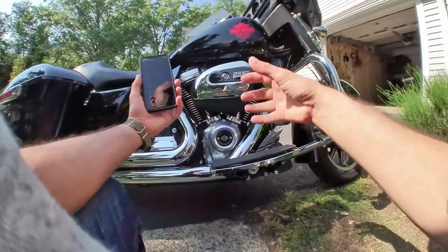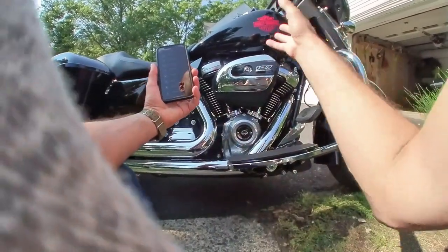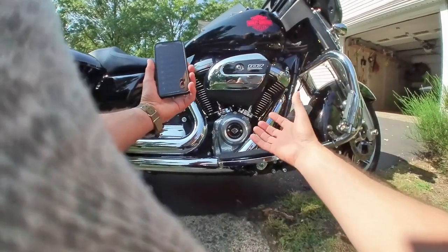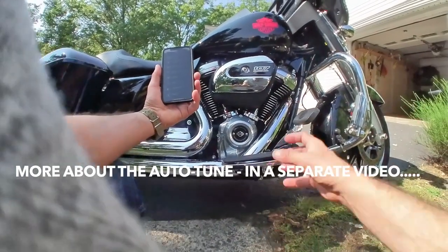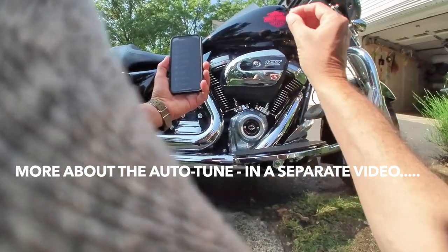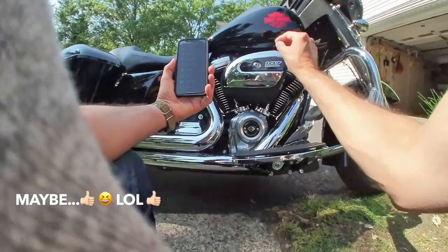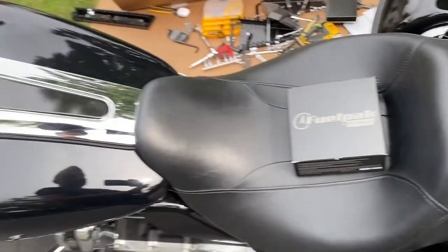As I've said already, as you've seen in the map, they don't have the option for the pro pipe with the standard air intake. And that's why they tell you to use the high-flow air intake. That's why you want to consider using the auto-tune because it's going to actually pick up all the data and information while you're riding and create and tweak a map that will be specific to your configuration. That's what I'm going to do — put it on auto-tune. So that's it for now, guys — a quick install of the Vance & Hines fuel pack FP3, easy, simple plug and play with a little bit of playing around with the application.